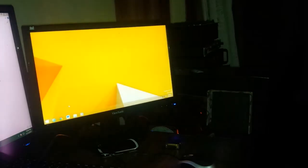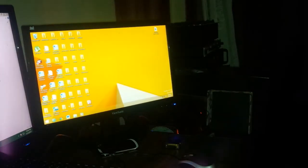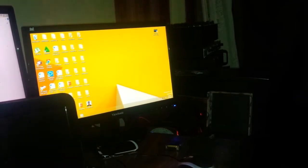So most definitely it is the display screen that has gone bad, because the laptop is up and running on my external monitor there. So obviously something went bad with the display screen. It can be a case where the inverter failed or the screen itself actually failed.